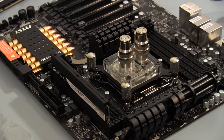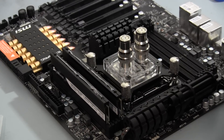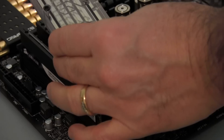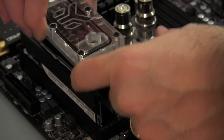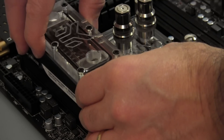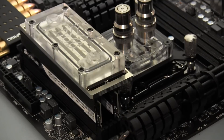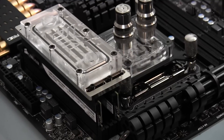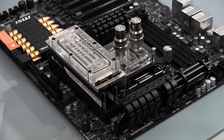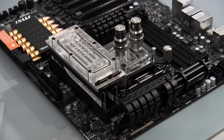I'll do the same thing to the next one. I've got two cleaned off and thermal compound on them. Since this is an X79 board, there's only four DIMMs in this particular one. On either side, I've got the EK that only seats for four. There is a wider EK RAM block that does six, but this is the EK RAM block times four. Let's see if I can get this lined up right. Put the screws in, see how she looks. That block is on — just trying to get it centered over where all the RAM would be. There's only two eight-gig sticks in there, but so far so good. I'll give you a down shot on it as soon as I get them all installed. I'm going to do the other side now.